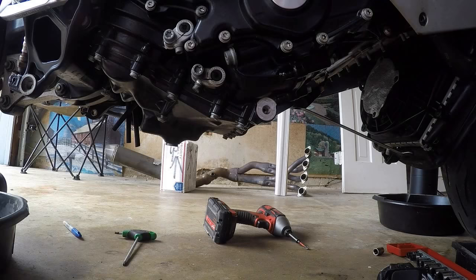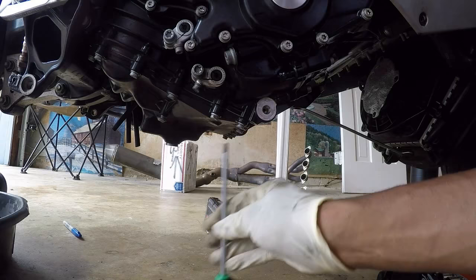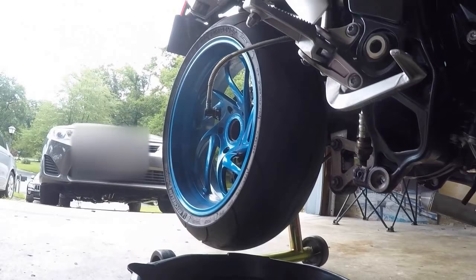What I did was take the liberty of loosening up the bolts. I like to use the pattern of going from corner to corner, corner to corner, going opposite sides just to loosen them up. I like to take my bolts out evenly with approximately the same torque because I don't want to bend anything out. Also, the oil has finally started trickling, so it's pretty much empty.